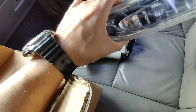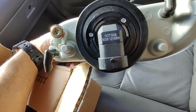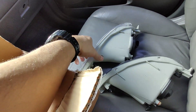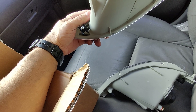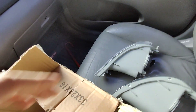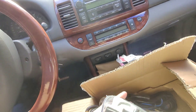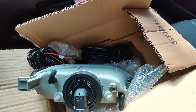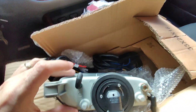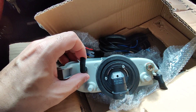This is the other fog light here — right and left side. You can see it has an R there. This one is 9006, 12 volt, 55 watts. So one is left and one is right. Also, you have here the adjusting screw, which adjusts the beam up and down. And this little rubber piece here is for moisture protection.